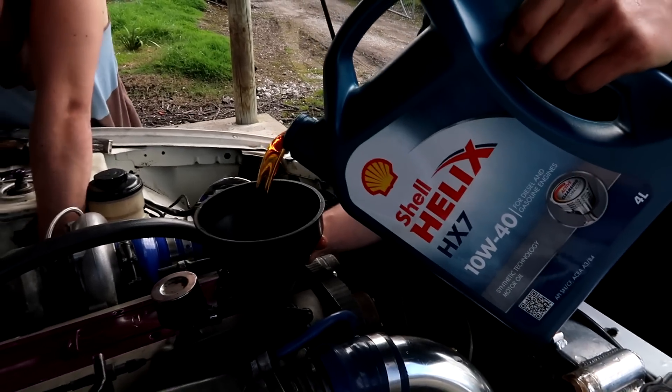Not far off starting it now - we're just tightening up all the coil packs properly, putting bolts in instead of just one bolt, doing things properly. We'll hook up the timing light, set the timing with the cam angle sensor and see how it runs. Also wiring up a temperature gauge - RBs are pretty commonly known to overheat at high RPM especially running a factory fan without a shroud. A $30 gauge might save the engine.